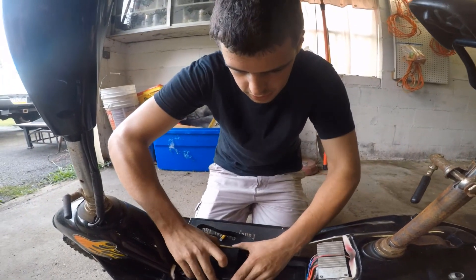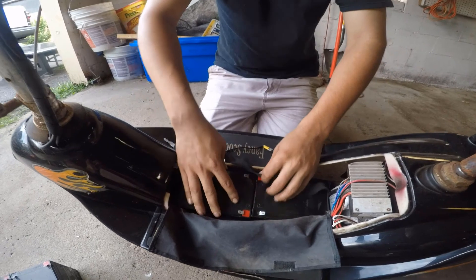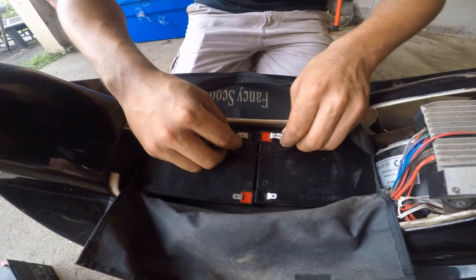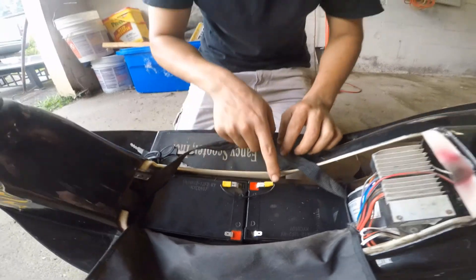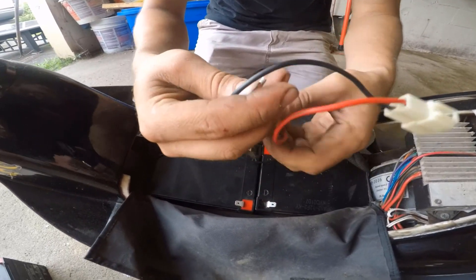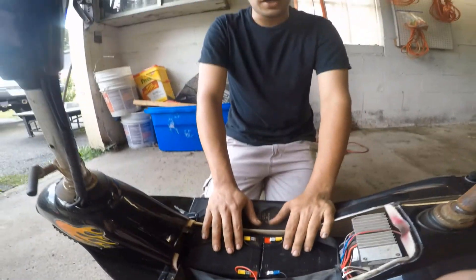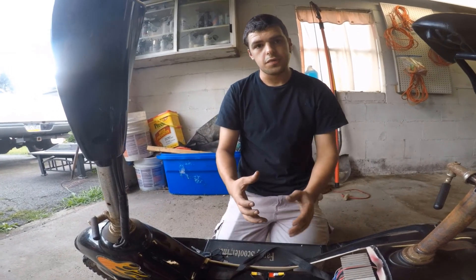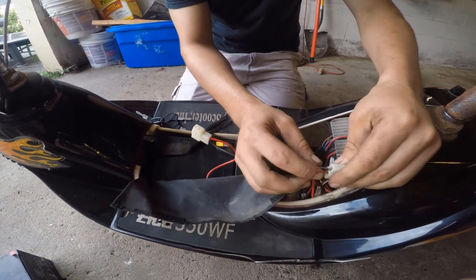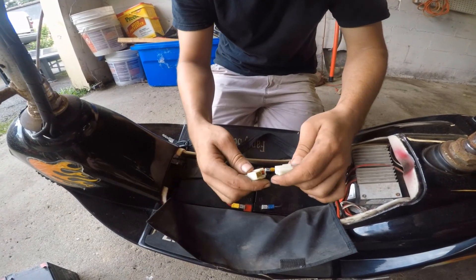A little bit of a battery displacement — I'm just going to take this battery and reposition it. My wiring wasn't made long enough, so what I do here is just go black to red on each battery: black to red, black to red. Then take the scooter connector and put that on the other side of the battery — again, black and red. Now these batteries are working together in series to provide their maximum power together. I'm going to go ahead and find the scooter wiring. I don't really like that, so I'll probably fix it later, but today I'm just going to do my best to get this to work.